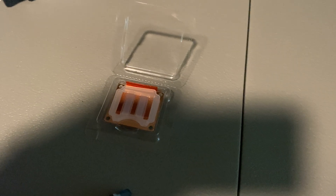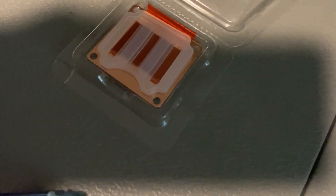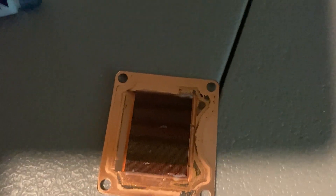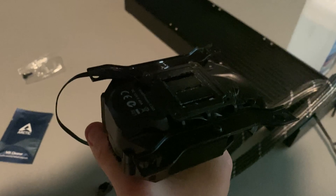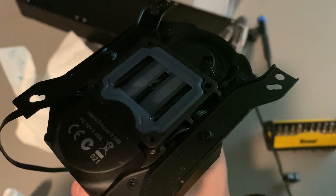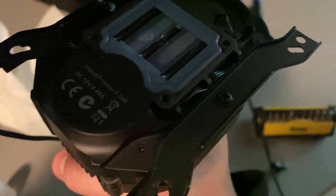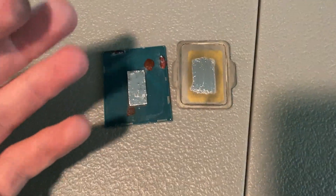Let's unscrew the current cold plate. AIO is off. Now you want to use something to get underneath this old gasket — it's black; the new one is clear. I also forgot to mention it comes with a little bottle of fluid to fill up the AIO. Here is the cold plate — as you can see it's a little dirty, which could definitely be causing some issues. I'm going to take a flathead bit and get it under. New gasket is in and I filled it up with some of the liquid. Make sure there is a raised part in the middle of the gasket and that the raised part faces towards the cooler so you actually can't see it. Now it's time to put the new cold plate on.